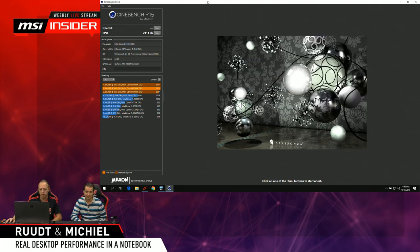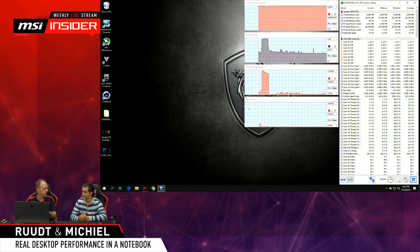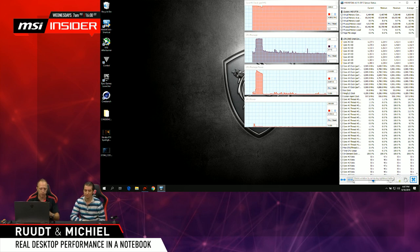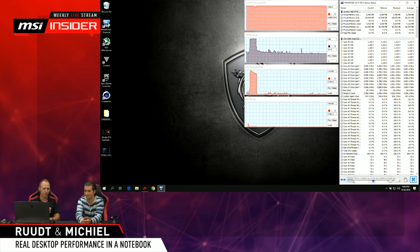So that's Cinebench. I think that's an impressive result already. Sometimes when the temperature is hotter in the room, it helps to lower it to 4.9, because then it won't throttle as fast as with 5 gigahertz. You put 200 watts in it and it will heat up so quickly that it will start throttling itself. So that's a bit of trial and error, also based on your ambient temperature. Mostly the first time you run it, it's the highest, and it will drop a little bit because it cannot sustain 5 gigahertz for very long, so it's actually pretty cool to fiddle around with what you can do in which environment. That's why the cooling stand might also help you to get a better score as well.